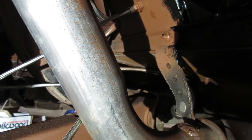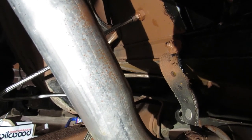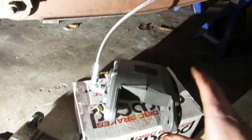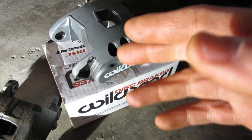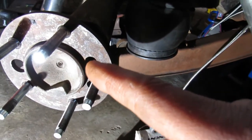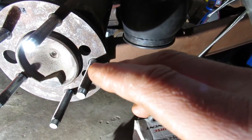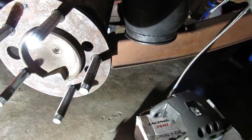This car is still getting undercoated, so it's red primer right now. That is a panel mount — 3AN on one side to an inverted brake fitting on the other. It makes running rear brakes super clean and easy, and if you ever need to swap anything out, you can just undo the line right there. The next part of this whole thing is to take this caliper, mount it up through some sort of wizardry bracket, and actually stop the car. Stay tuned for all that. Thank you.